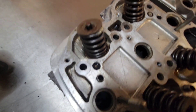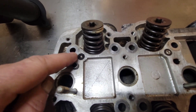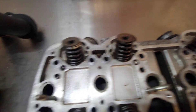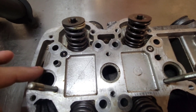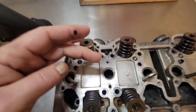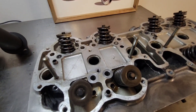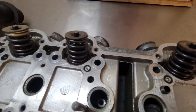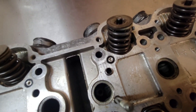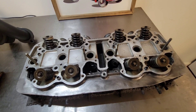As you can see here on this end, lined up basically so they can use the same pieces. This is just an o-ring that seals a block off — it doesn't go anywhere, it's just an o-ring that seals it to the mating surface so that the oil stays in the assembly and does not leak out on either end. The assemblies just bolt on up here. These oil restrictors are really what matter the most — big time. You've got to have oil up here to your valve train and your camshaft, otherwise no go.